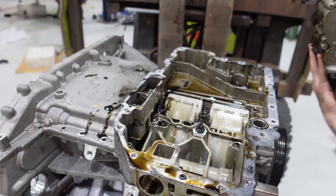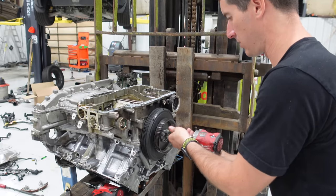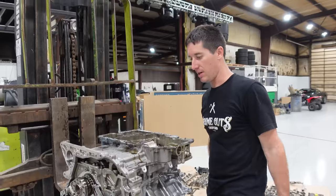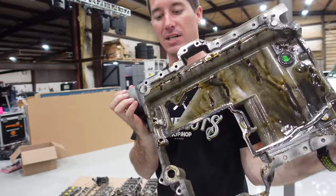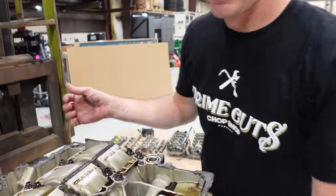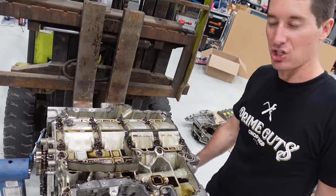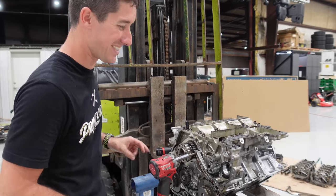We've got to pull a few more fasteners — crank pulleys coming off because we're ready to separate the lower pan from the upper. The lower oil pan is off. That was a nightmare — it took the sledgehammer hitting very hard in the only places you can hit, which are those two bearing housings. Which means we can finally get to the meat of this engine: the crank and the mains. We've got a few more T30s to get out of here now that we've exposed them. We can grab some E-torx sockets and take out all the mains, and we can finally see the crankshaft. There are probably only 50 bolts left in this engine, which is an insane thing to say.